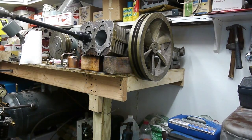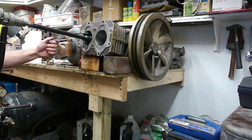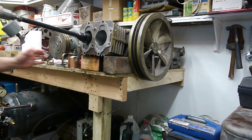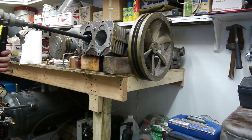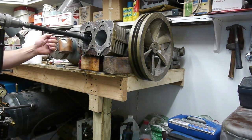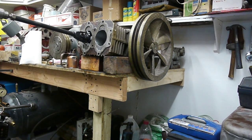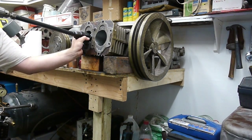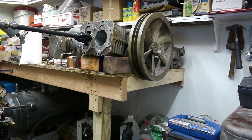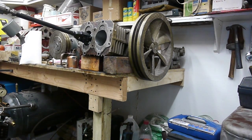Right now this works really well — you just have to make sure to use a lot of oil. We used about a quarter of a gallon to do the first hole, which is about four refills on this little oil can. I'm not oversizing or anything; I'm just going to clean up any of the irregularities in the cylinder.